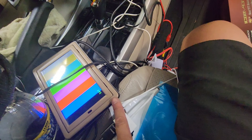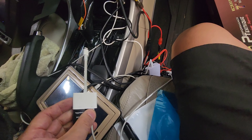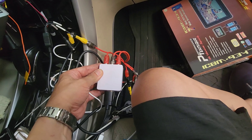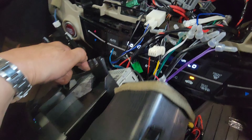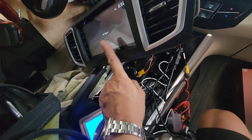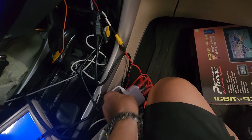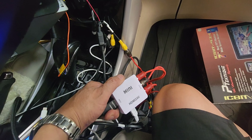What we are doing is custom for an iPhone, so it's going to get this HDMI conversion, and this HDMI to RCA out. This RCA is connected here along with this Kenwood video AV input. So you get the iPhone mirror here as well as down here. You do need this HDMI to AV out.